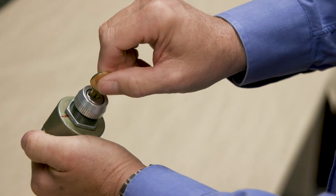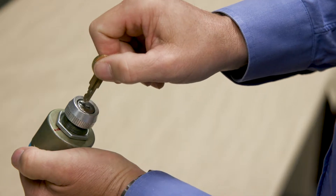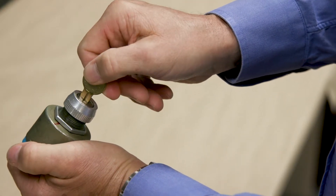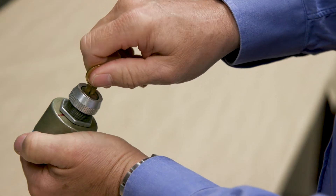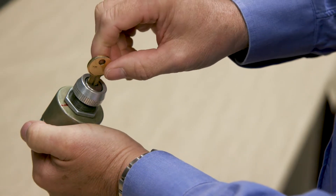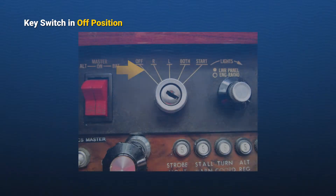The key was in the pilot's pocket. The NTSB has previously investigated accidents in which the worn ignition switch and/or key resulted in either uncommanded engine starting or serious injury after the engine momentarily started uncommanded. The common theme in these accidents is that the ignition key could be removed from the ignition switch in several positions other than the off position, and while ignition switches and keys are designed to only be removed in the off position, this condition may go undetected.